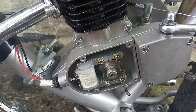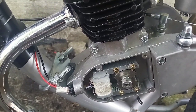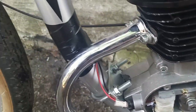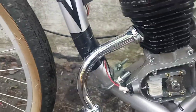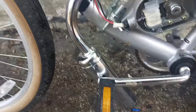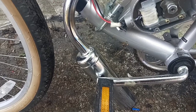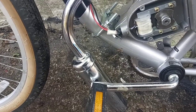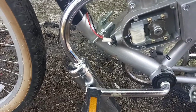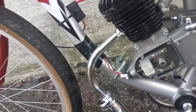What I ended up doing — I checked the magneto magnet. I was thinking maybe it was weak, but it's nice and strong, so we're getting a good spark. Then I said to hell with it and I took the exhaust off. The exhaust pipe on these bikes is pretty much the same as what you find on the 66, and it's kind of restrictive anyway compared to like an expansion chamber, which you'd find on a two-stroke supercross bike.